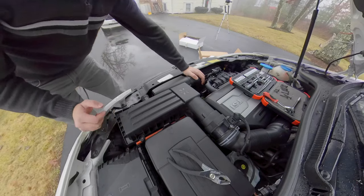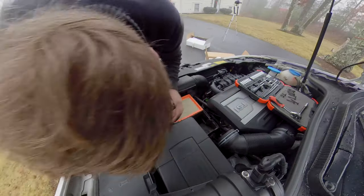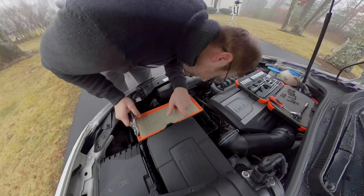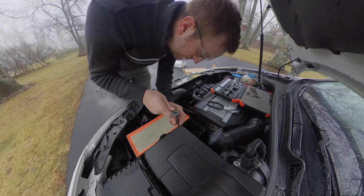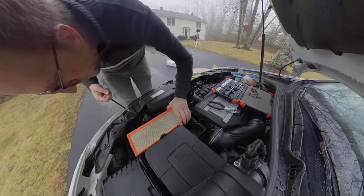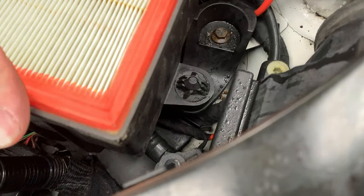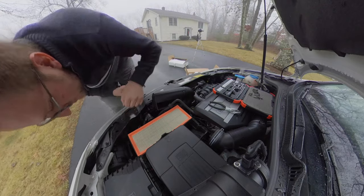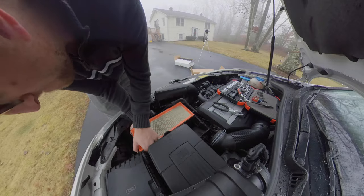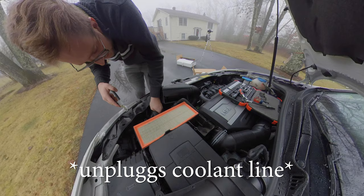Okay. I'm kind of straining the mass airflow sensor wire right now, so I'm gonna attach this tubing here. How do I get this box out? I know there's a bolt here, and there's a second one here, but it has this rubber sort of bushing. So here's the airbox, and this rubber bushing is holding it in to the whole tray system here. So I think I just need to pop that off. Aha! Oh shit.